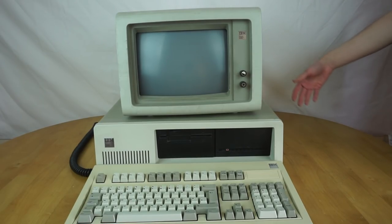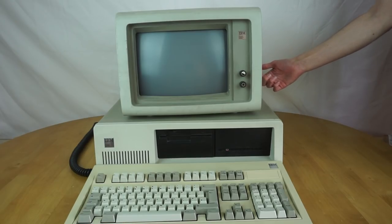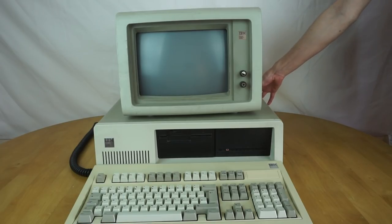I thought, well, that's a pain. Took it apart to see if there was anything obvious. I found when you switched it on, there was a slight click from inside the power supply and the fan twitched. So I did just the usual diagnostics — unplugged the motherboard, left the drives plugged in, switched the power supply on, and it fired up absolutely fine. Unplugged the drives, plugged it into the motherboard, switched the machine on — no power again. So any time the power supply was connected to the motherboard, it was shut off.